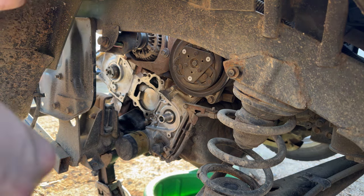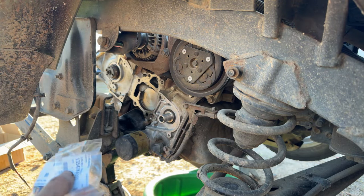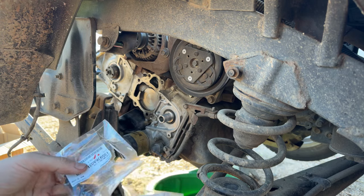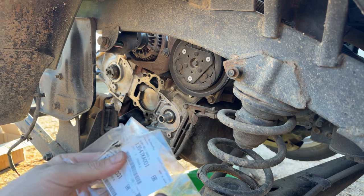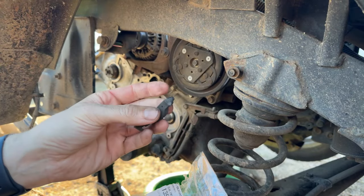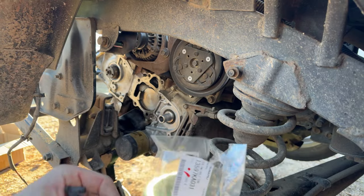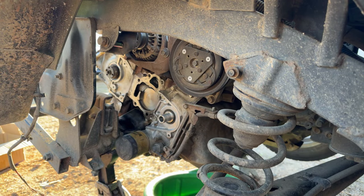So guys, unfortunately, I forgot that that spare set of timing components for an EN07 I used on my last Sambar. So we do have some of the old seals that came off that truck, and luckily they were not swollen up, because that last truck only had like 36,000 kilometers on it, and I just did it for age rather than contamination. So these aren't swollen, so we'll use these on this engine instead, just so we got something there and it's better than nothing.